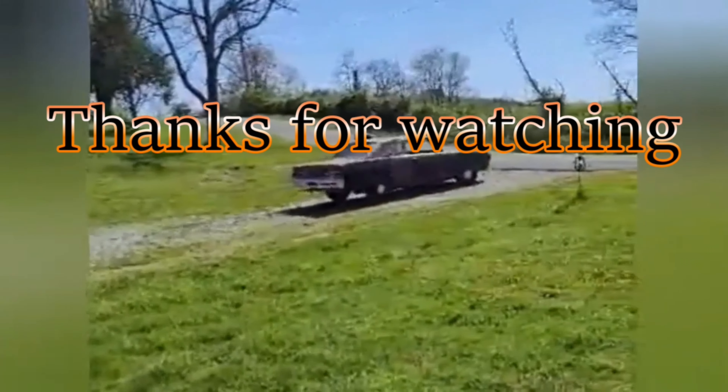Alright, got everything put back together. Got the arm put on there. As you can see it still works. Now comes the daunting task of getting this arm reattached. Last time it was a pain because this bushing in here is press fit and you don't have enough room to get in there to press it in, but we're going to work on that real quick. We'll try to get this arm positioned — about right there. The easiest way to get to it is right there, so I'm gonna grab a pair of channel locks and get in here and try to press this thing in.